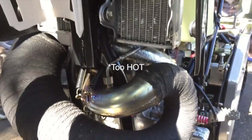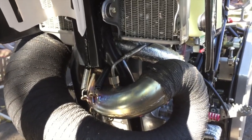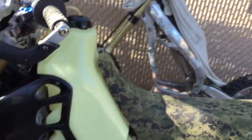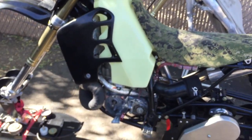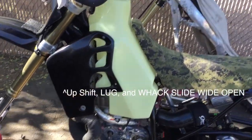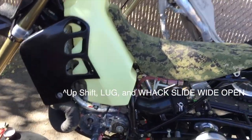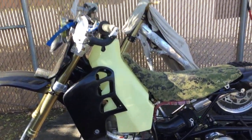The thermocouple probe is six inches away from the piston skirt roughly. Happy EGT places are like 1150°F. When it starts getting above 1250 to 1300, you definitely need to start backing off, otherwise you can melt the piston. What I do to cool it down is downshift and then whack the throttle wide open — all that cool fuel going in will bring the temperature down almost instantly, like 150 degrees, and cool the piston off.